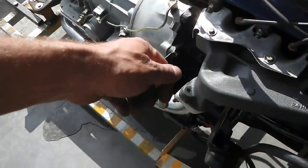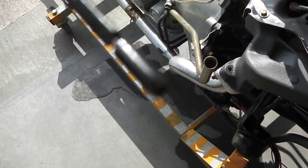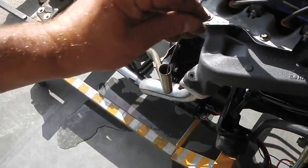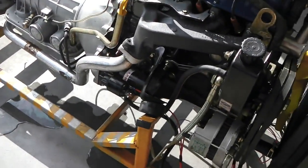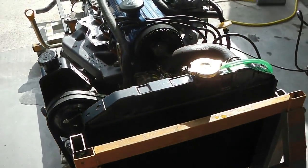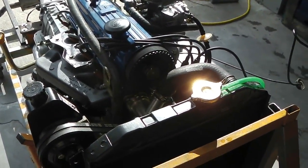We're going to take another dipstick reading because we expect fluid to have gone, and it has, it's just on minimum now, so a top up required on the auto box. There's plenty gone in but it needs some more. We could engage the gear and see if we get a rotation, we should do. Going to get some Dexron 2 now, let that settle a little bit and we'll go around and have a real close examination, see if we can spot anything.